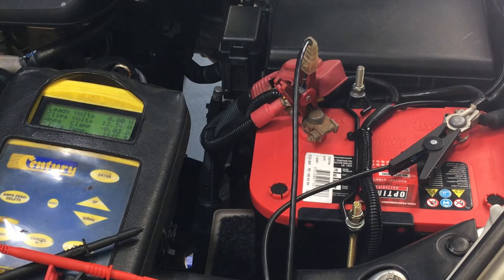You really need to test the alternator, and that's what we're going to do. If your car won't start because the battery's flat, don't just think battery - it could be your alternator not charging, which is why your battery light came on. Often the alternator is the cause of the flat battery. Average life of a battery is four years, so I'd recommend replacing batteries at about four years if you want ultimate reliability.